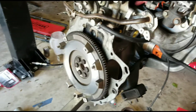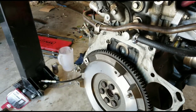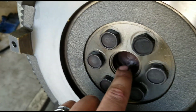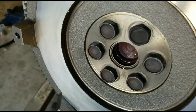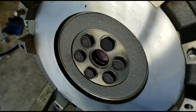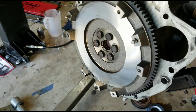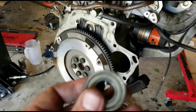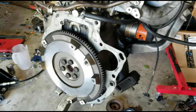I just had a stupid moment. Basically we got everything torqued down and on there. Got my new pilot bearing, and unfortunately, as it looks like, the race for the old pilot bearing is actually still in my flywheel. I didn't realize that when I pulled it apart — basically everything fell apart. So now we've got to go ahead and rip all this off. I'll take this flywheel over to David's house, use the press, press that old bearing out and press this new one in. Should have done that first — lesson learned.